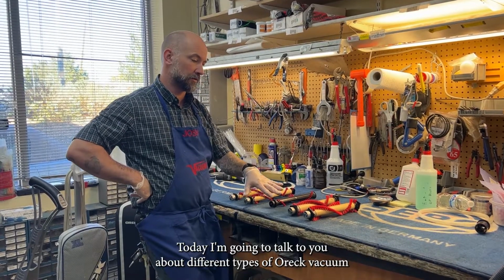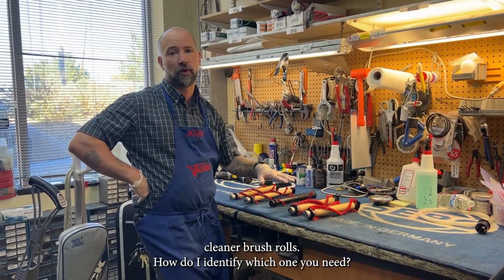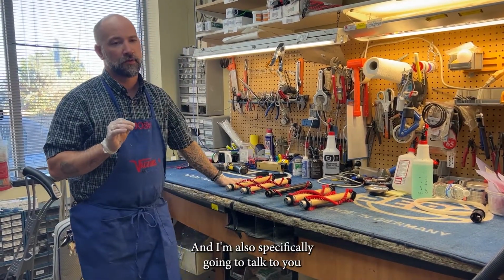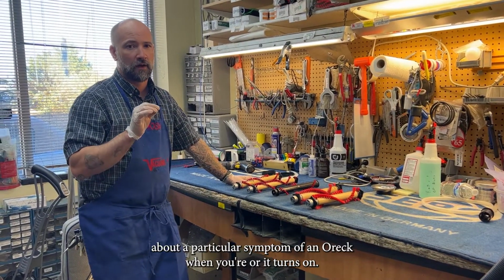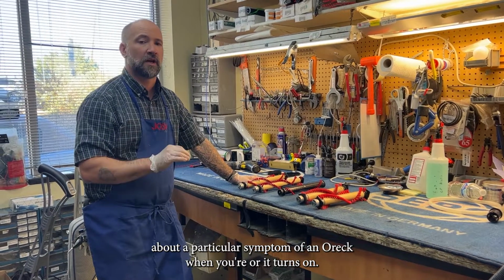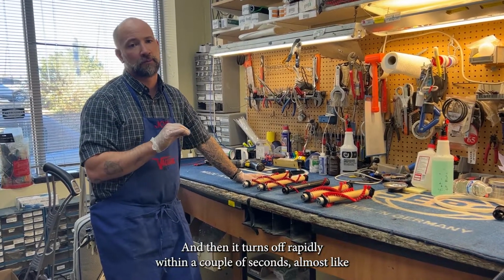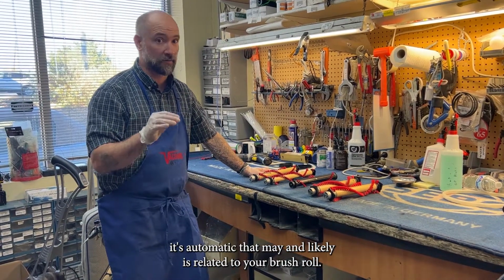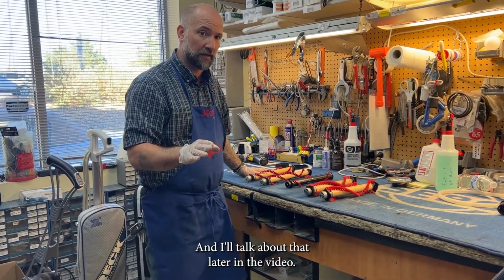Today I'm going to talk to you about different types of Oreck vacuum cleaner brush rolls, how to identify which one you need, and I'm also specifically going to talk to you about a particular symptom of an Oreck, when your Oreck turns on and then it turns off rapidly within a couple of seconds, almost like it's automatic. That very likely is related to your brush roll, and I'll talk about that later in the video.